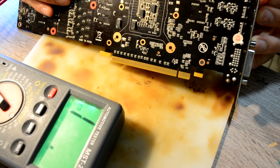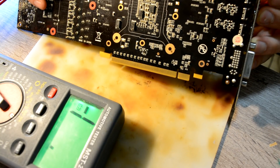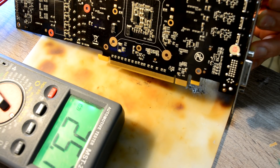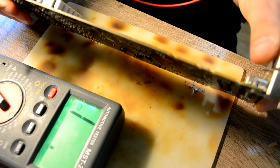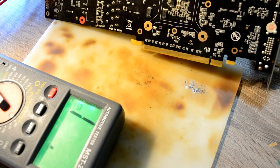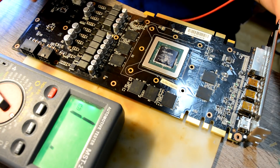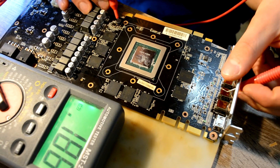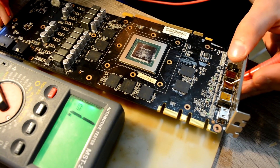Let's go straight to our GPU resistance. 8 ohms - normal. 25 ohms for memory - memory by the way is two-phase, one for those graphics cards - normal. PLL should be more than 200 ohms. 600 is normal.